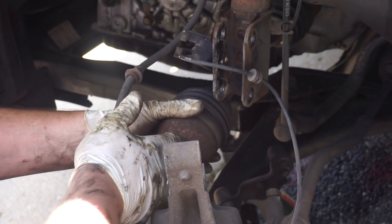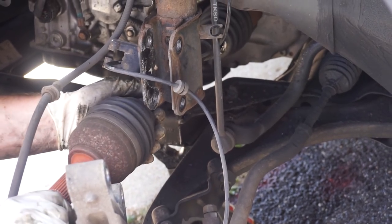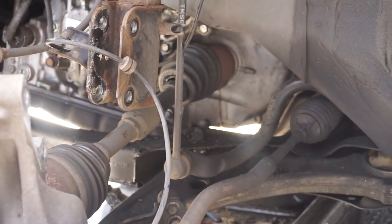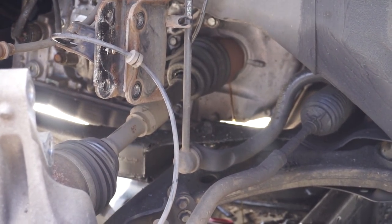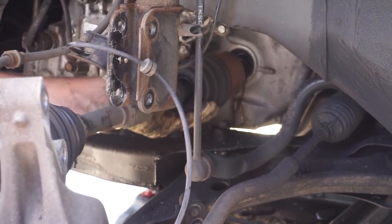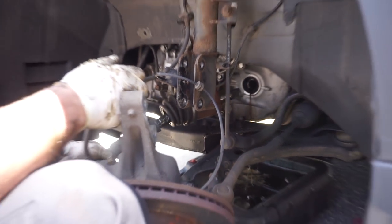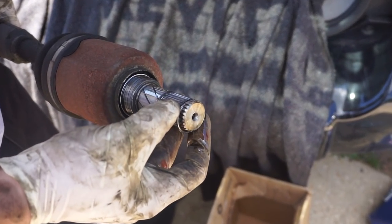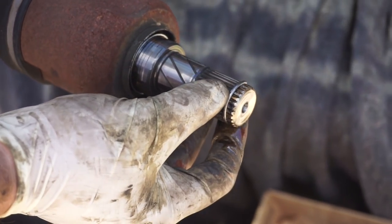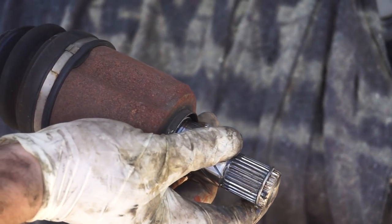How I remove these is — if I'm very lucky — I can get the C-clip to just pop right off. We're going to try that by making sure I'm perfectly even and just chug and tug. It's starting to come out, so I'm going to go ahead and put an oil drain pan underneath to capture it. The resistance you're feeling right here is the C-clip, which is what keeps this axle from popping off when you take the wheel and nut off. You have to have it perfectly flat — if you have it at any sort of angle when trying to remove it, the C-clip is not going to allow it to pop off.